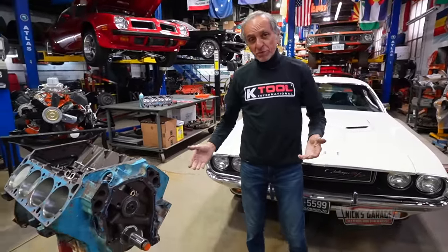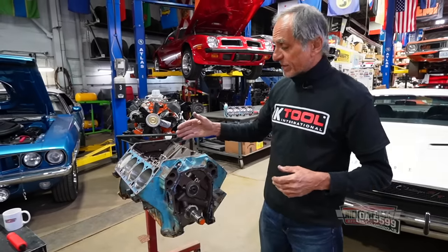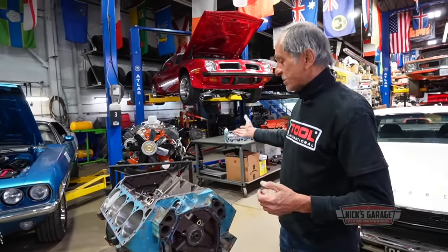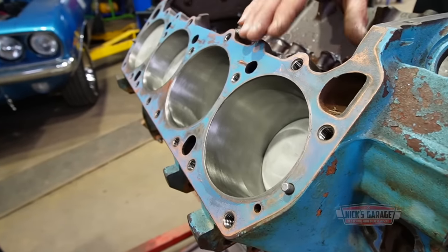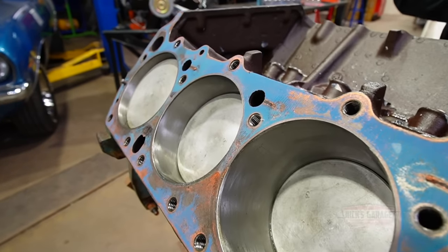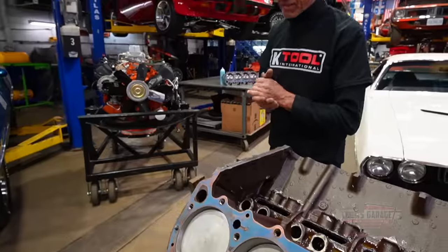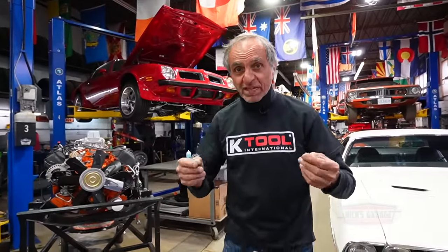I know this hasn't been rebuilt, but one thing I never saw in my life before was the deck height. Now, the cylinder heads, I've had them checked, they're 87cc. The heads were not shaved down. And if you take a good look here, when we removed the cylinder heads, he had the blue Felpro head gaskets, which are 43 thou thick, which are pretty thick head gaskets. Meanwhile, from the factory, they come with a 20 thou shim gasket, like so.